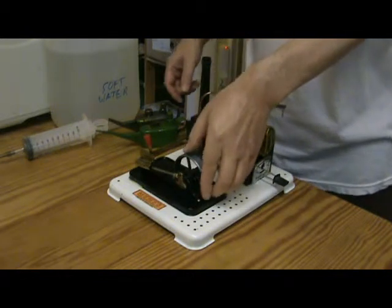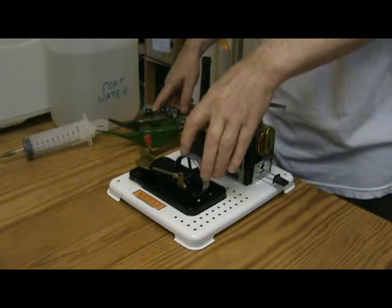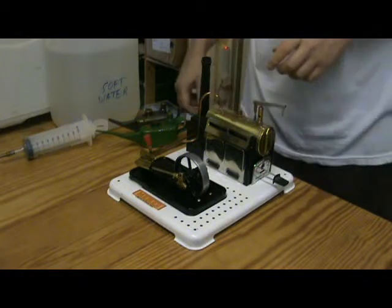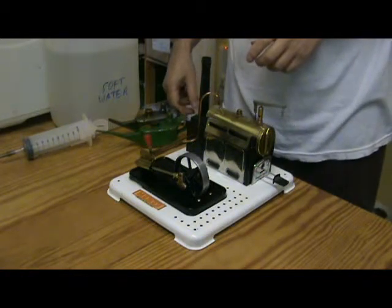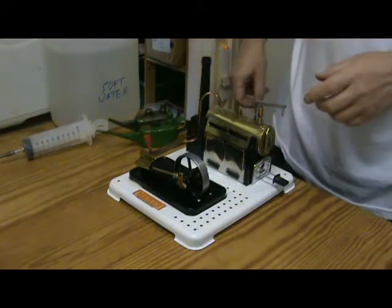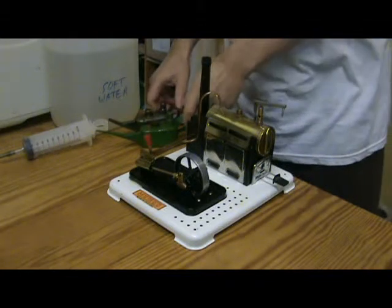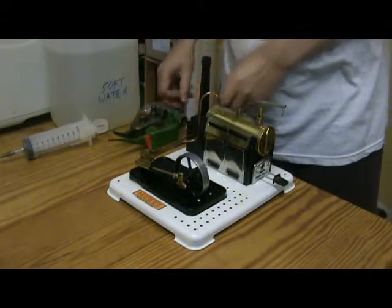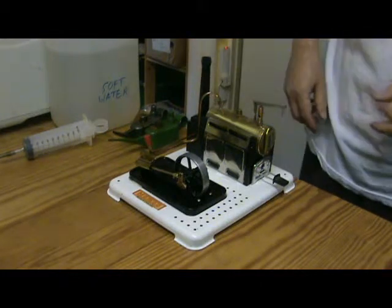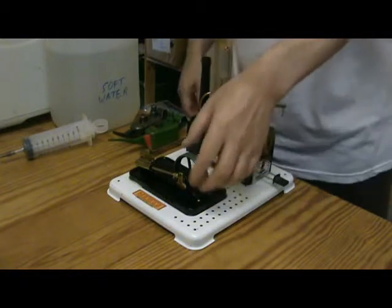I used a trick which I used before, in that I removed the piston from the cylinder and dipped it in Brasso, and then by hand worked it up and down and twiddled it inside the cylinder for a couple of minutes to free it up, and then cleaned the Brasso out, of course. It seems to have worked, and it's worked in the past.